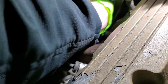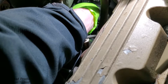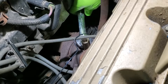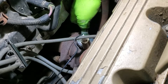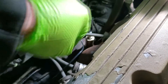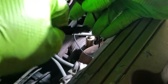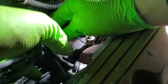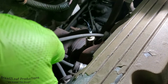I've got the wrench on there and can get a little bit of movement on it. Walking over to the other side to get a better handle. Got it on there — one good tighten, one more good turn, and that should be good. Obviously you can't get a torque wrench in here, but that's okay. There we go — fully installed and tightened down. Last step, don't forget to plug in the wire so the computer can actually see it. Line up the tabs, snap it in like that, and slot the wire into the little holder on the firewall. Make sure your wire is not touching the exhaust and you're good to go.